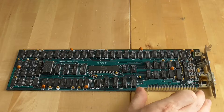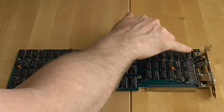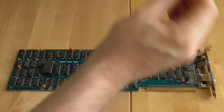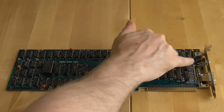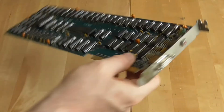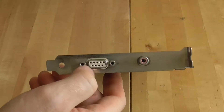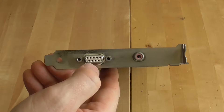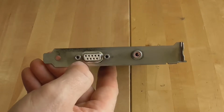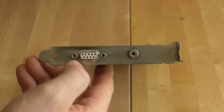The card itself is an 8-bit ISA card, designed to be compatible with the IBM PC and any clones. It has a light pen connector so you could draw graphics on the screen. There's also a composite video output, and of course you can tell it's a CGA card because of the 9-pin CGA connector. This looks a lot like a VGA connector, but VGA has 3 rows of pins whereas this only has 2 rows with 9 pins. In fact, you could use a 9-pin serial cable to connect this to your CGA monitor.